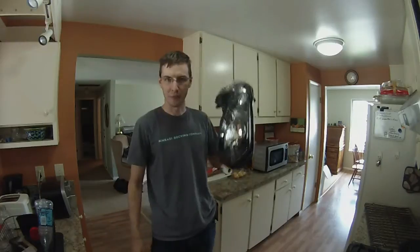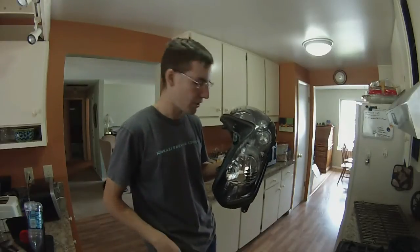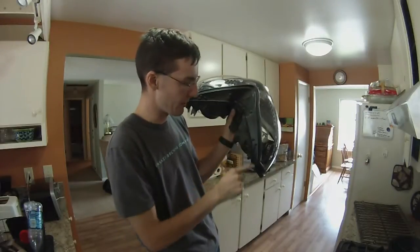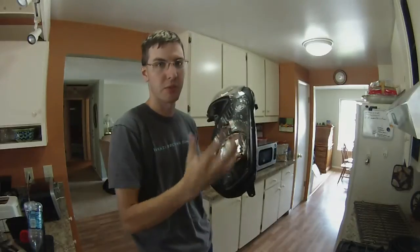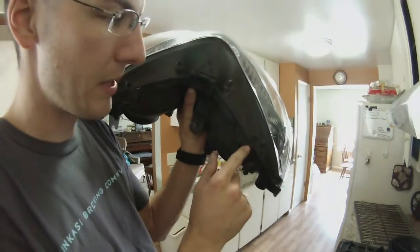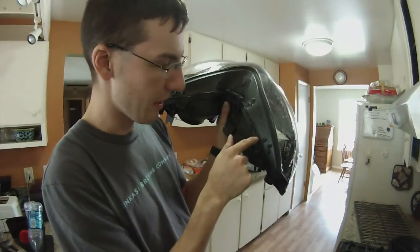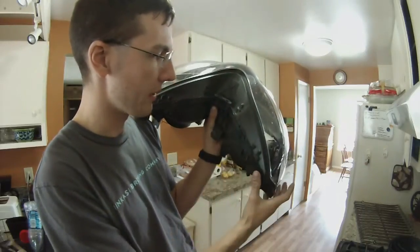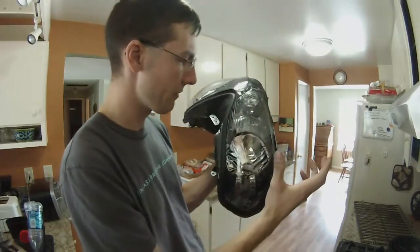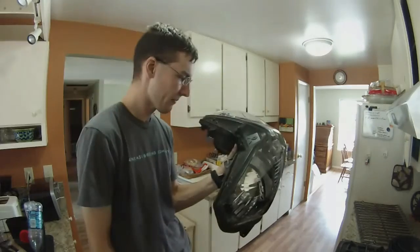What I have here is a $300 piece of very expensiveness that is going to go into this oven set for 200 degrees. It's going to sit in there for approximately six minutes — maybe more, maybe a little less; I'm going to gauge it. The purpose of putting it in the oven is to heat up the glue in this seam right here. I don't want to melt the lens, which is why it's only in there briefly at such low heat. I only want the glue in this seam to get hot enough to be pliable and melt away. After I pull it out, I'm going to pop the tabs all around the headlight, get into the groove with a screwdriver, and start prying the housing open.